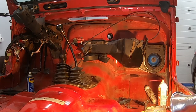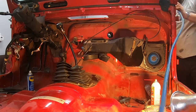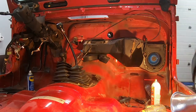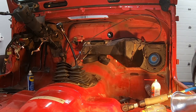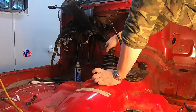It took me a while to figure this out, but there are actually four bolts that hold this thing onto the firewall, and you can only get them from the other side — one on the left, two on the right, and one in the middle. The bottom bolt on the right side, near the motor, is underneath the battery tray and it's a little bit hard to get your hands on, but I managed to get that out.